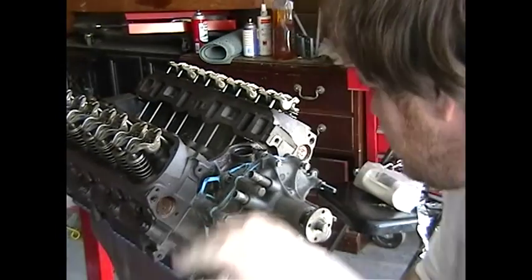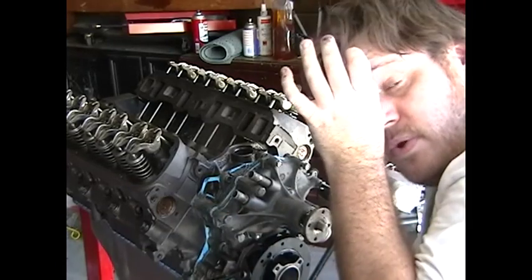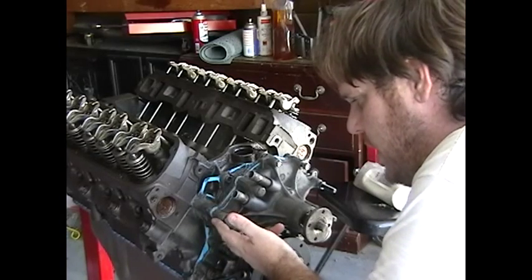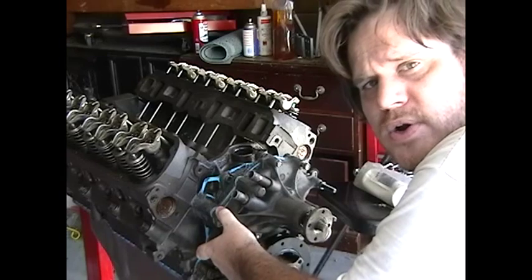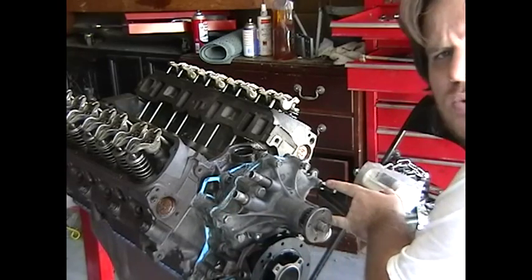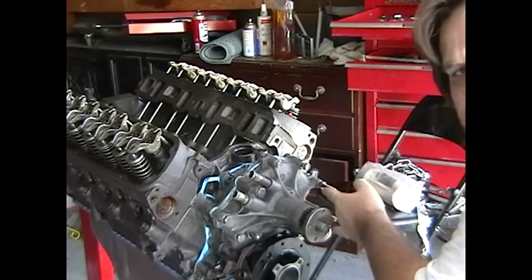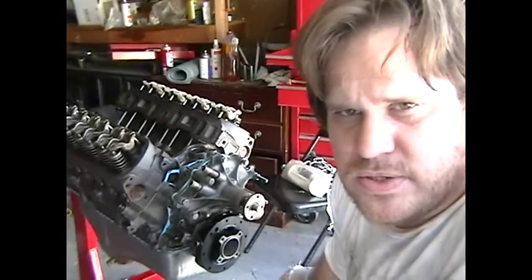So basically, the two bolts that go into the coolant passages, I'm not sure if they go into the coolant, but they're the nearest to the water pathway. So these two got sealant, and these two bolts got sealant also. And that's the same over here. These both go near the water pathway. So I just put sealant on it just for good measure.